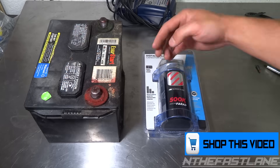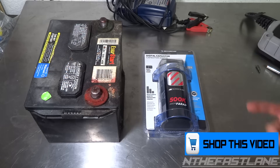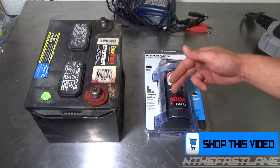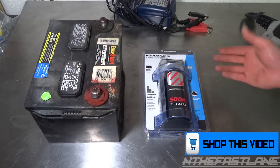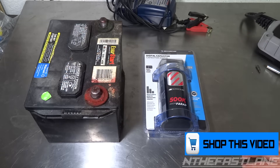So if it starts to go low on the battery, it's always going to keep the amp at that voltage. Now you can get into a certain setup where you've got multiple amps or a very high powered amp that's pushing a lot, and the capacitor can't even keep up because the battery is just not feeding it enough. That's where you would probably need a second battery in your trunk with a capacitor — I've seen people even run multiple capacitors.